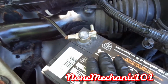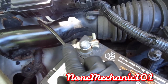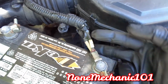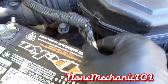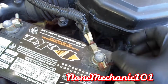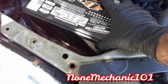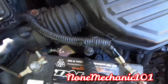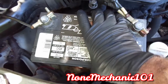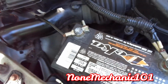So what I'm going to do right now is replace the negative one, because it's the only one I have right now. In my next video, hopefully I'm going to split these, because we still have some movement on it, and put a new post on this. The other thing I saw is that this battery is loose, so somehow we're going to have to tie it down, get something to hold it. But for now, I'm going to change the negative cable.